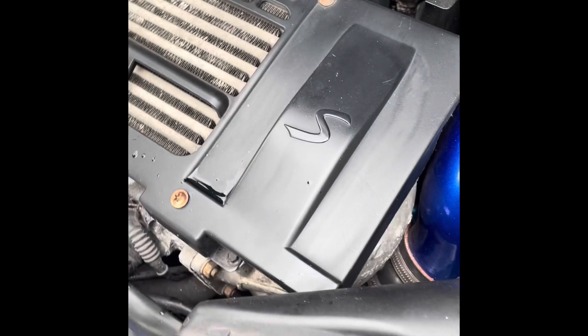There's a bleeder right here and a bleeder right down there. We just let the blue coolant stream out, and I put the heater on max. It's hot now, so time to wrap it up.